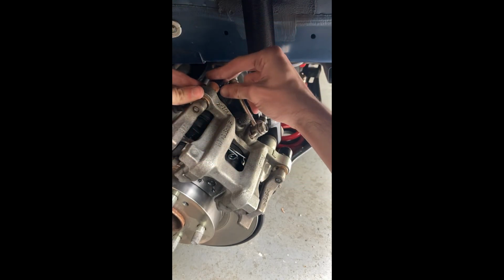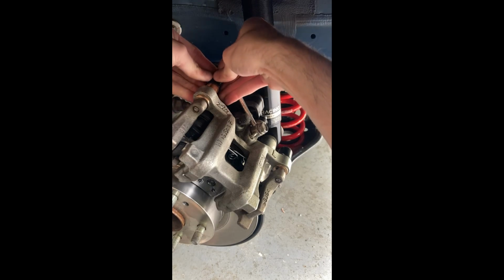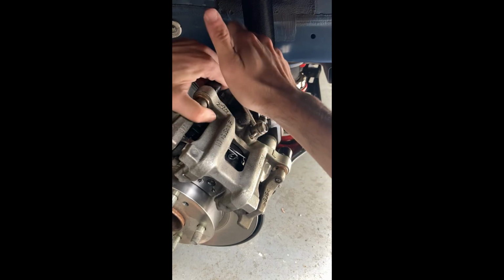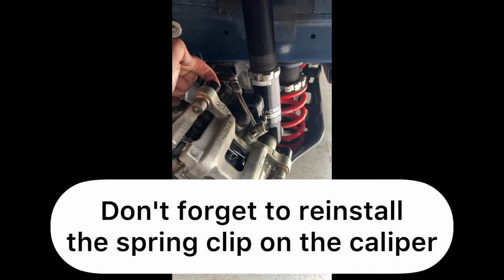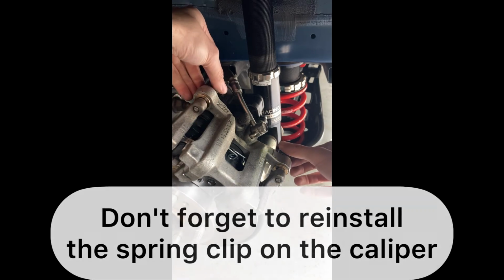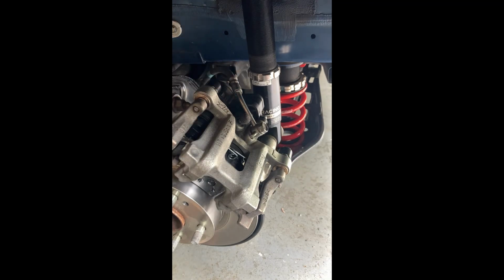And you may notice that once you get the cap over it and you push it down all the way, the bushing will kind of suck itself against the caliper. And that's its natural resting position. It'll mostly stay there for the most part. And that's it. You got your bronze bushings installed, you're ready to go, and that caliper won't twist and torque around like it used to anymore.